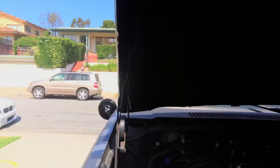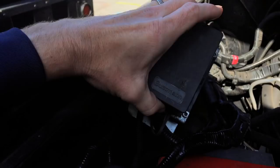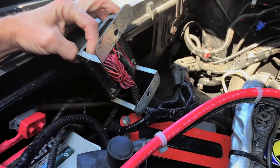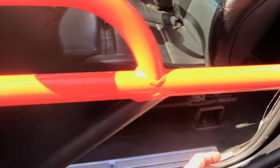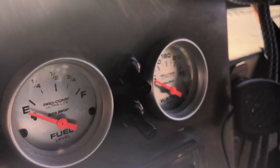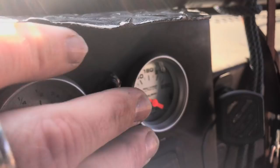Coming over here, you will see that in my Pac Fab harness, I've got this fuse panel. And this fuse box has two relays inside it that are for my fans. I just need to tee into these lines, and then I'm gonna run it to the switches inside, which are, let me show you guys those. So these are just gonna be connected up to the fans, and they are just gonna bypass the signal that goes to the PCM and make sure that the fans aren't getting triggered to turn on. They're not gonna be carrying any power because I don't want power from the fans being drawn down over this voltage drop. So yeah, that's what these guys are gonna be for.